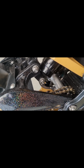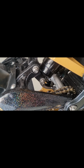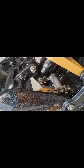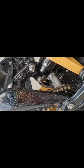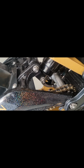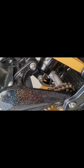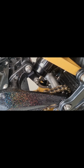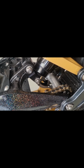You also do need to, with the dust caps, drill tiny little holes in the end of them, because grease needs a place to escape from, so that you can then replenish the actual bearings, and it needs to be past the bearings. So you'll fill up the cylinder itself, and then as that fills up it pushes out past the bearings and then comes out the grease ports. On previous ones that have been designed, that is a failure, because you end up compressing the actual shaft itself, the cylinder, and all that does is make it hard for the bearings to run in a compressed environment.